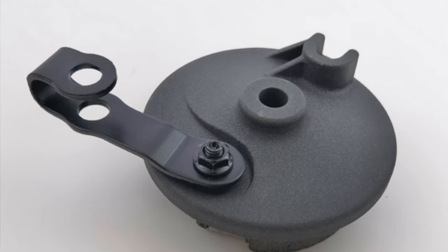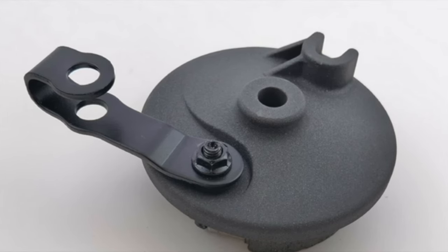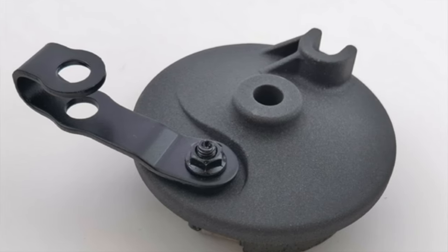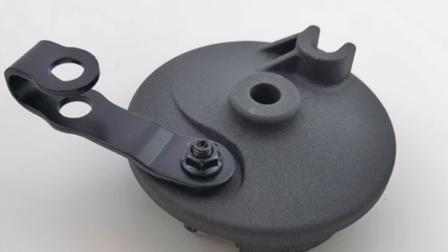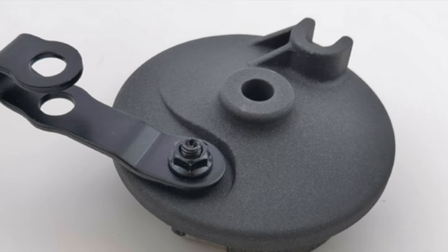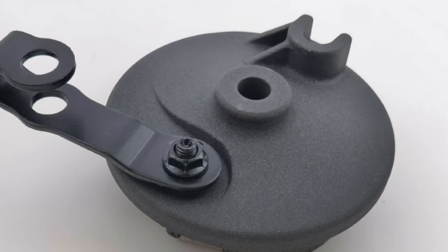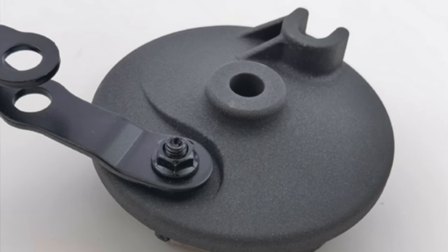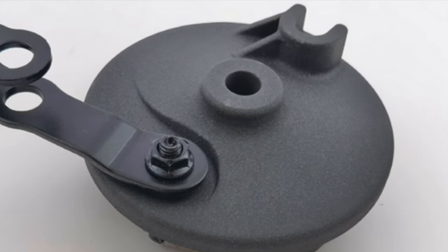After about three months of the Xiaomi I got the Ninebot Max, which as you all know has a drum brake, so that is the only brake I didn't end up buying off Amazon — you have to get that directly from Segway, at least you did back then. These days you can order it from AliExpress or wherever. Drum brakes are great in that they last a couple thousand miles before you really need to service them, and they're low maintenance — you don't need to adjust them very often at all.